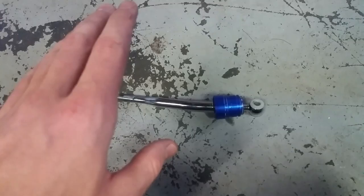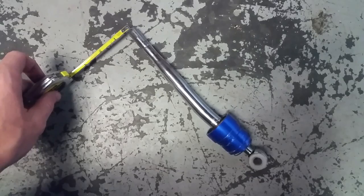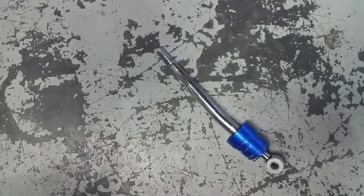To talk about the shift itself — I measured and it's around 3.5 inches. I don't know the exact stock length, but it's very short — I'd say about half as short as stock. It's not too short; you're not going to miss gears, and I actually think it's easier to shift. You can go measure your own shifter and compare to get a size comparison of how much shorter it's going to be.